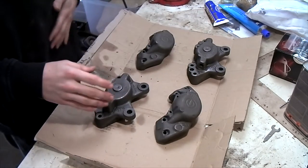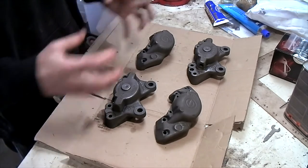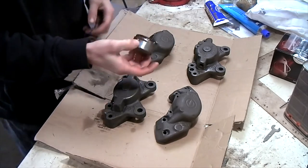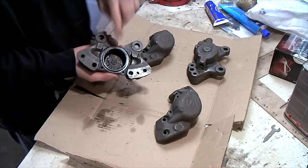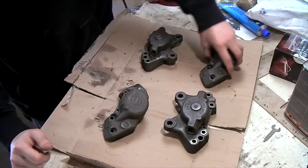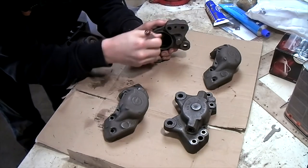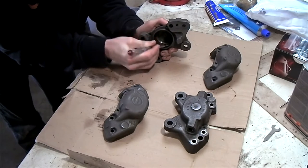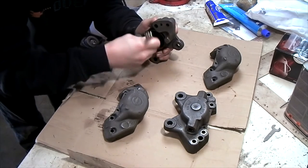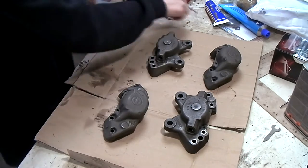Before I was able to split these I had to get the pistons out because they were seized in the bores, and I used a grease gun just to put grease in there and it pushed the pistons out. This is what the pistons look like — they have quite a bit of corrosion on them so these are scrap and we cannot use them. We are going to start off by cleaning the inside because there is still a little bit of grease left, and we are also going to take the small rubber seal out that is in the center — just take a small screwdriver and try to go around.